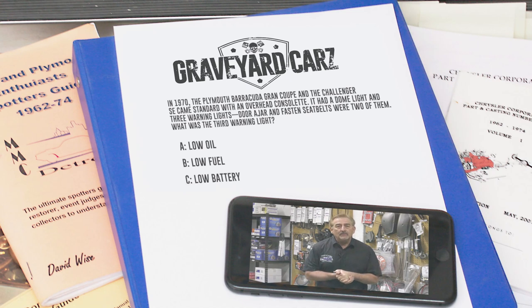All right, ghouls, how did we do on this one? It's a C26 overhead console — it had three warning lights. If you said low fuel, you're absolutely right. It was a little low fuel sentinel box up behind the dash that would receive the signal when that gauge started getting low and kick that light on overhead. The seatbelt light worked off a time delay relay — as soon as you turned the key on, that light would shine for maybe 20 to 30 seconds and then go out. As far as the dome light, those worked off of plungers at the very back edge of the door, very much like the ones at the front.